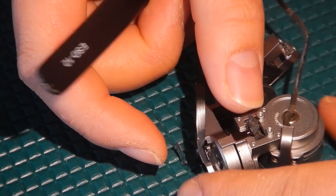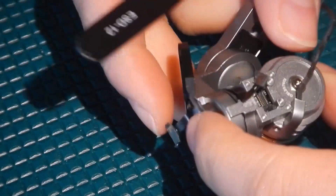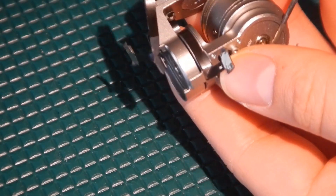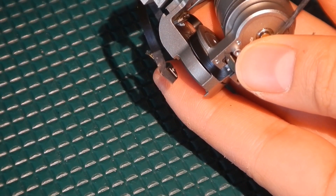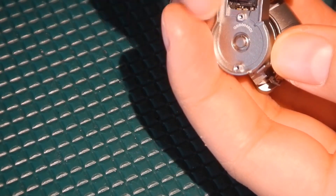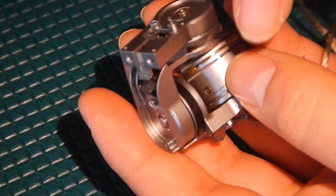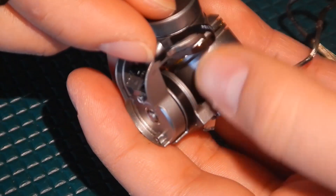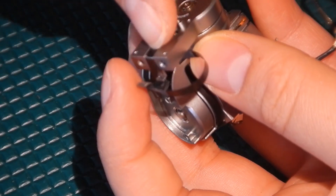Now that this portion is out, just go ahead and peel it off a little bit. As you can see, it follows this piece of the motor in a curve and kind of does a little loop back — that's where the second connector is. It goes through this hole and connects in there. Then the rest of the cable goes up through here and around this motor, then bends back and goes onto there. Hopefully that helps when you're trying to put it back together.